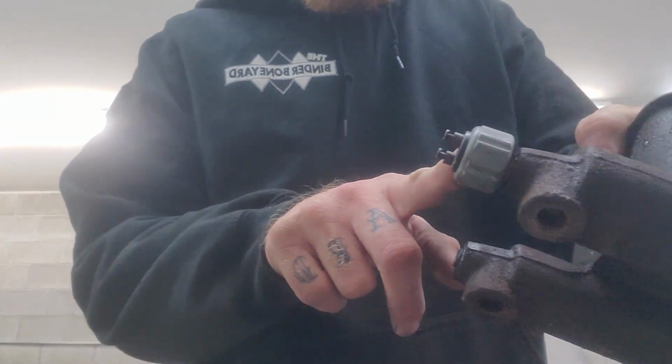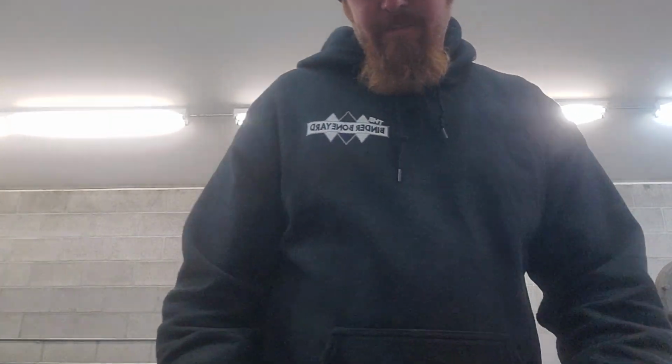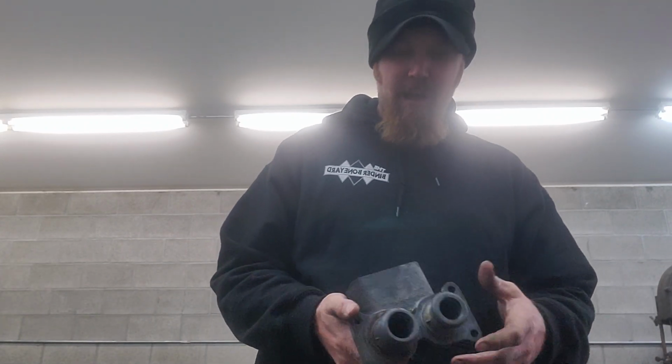And then once that's apart, a lot of them have this brake light switch. Unscrew that out of there. And then what I like to do is I soak them in, I guess it's phosphoric acid. If you buy it at Home Depot, it's called Clean Strip. It's like concrete etch. It's green, comes in a plastic jug.